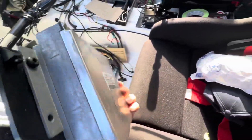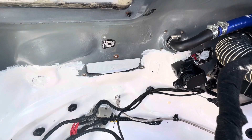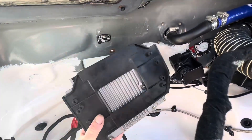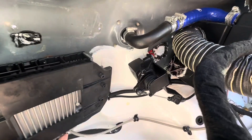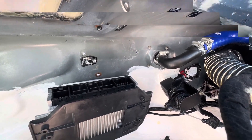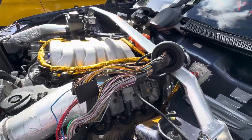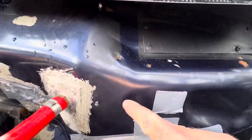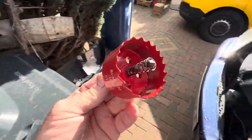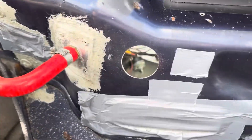While I wait for the PDM to arrive, I'm going to get the ECU inside the car. There's the factory ECU — it's going to go kind of there somewhere. That was the old hole where the wires came through because it was in the engine bay. There's a throttle control there, and I'm going to drill a hole just about there so the wires can come through. That's got me a grommet pass-through for the engine loom — that was a pain to get over there. I'm going to make a hole about here, so let's get drilling. Pilot hole first, then the hole saw. That's the hole cut.